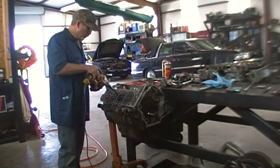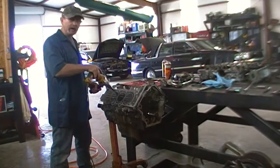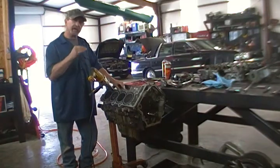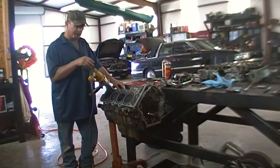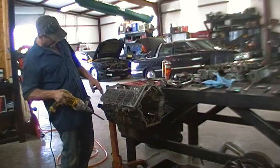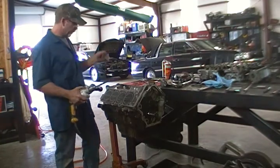You know you're at the bottom when you hear the solid connection. Then I let it spin for a second and pull all the chips out. When I'm doing this job, I'm doing it very quick — get in it, get it done, and get out of it. I very quickly go through it. You can just — you've got full body contact at the bottom, and when you pull it out you can see there's no chips left in there. That's because at half-inch, it's touching the walls and cyclones the chips out.